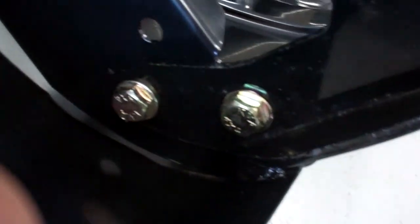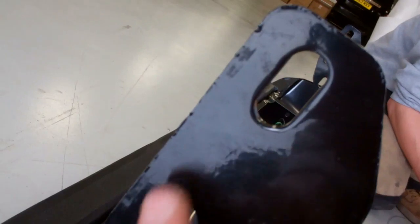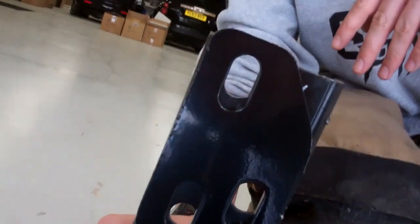The bracket sits on the outside of the gusset plate nearest the corner of the bumper, with that little ledge at the bottom. There are two sets of holes in the bumper where they mount, so you can bolt them to either pair of holes giving you a little bit of adjustment. Unlike the Nissan one which has holes, the aftermarket brackets have three slots so you've got an extra degree of movement.